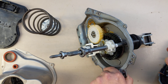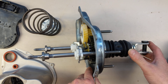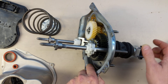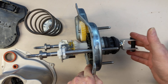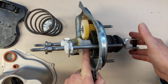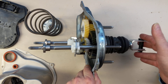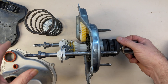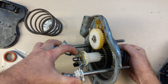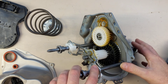Now how do they know how to run the motor? This is fully fault tolerant. If something fails and the motor doesn't work, or even if it seizes up, you can still press. This is pressing basically on the master cylinder here. There's an overrunning clutch — it's just a gear that meshes with this gear — and you can press this and still activate the master cylinder manually. And when you do, there's a spring in here that pops out when I put a lot of force on it. So this is basically sensing how hard you're pressing.